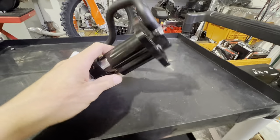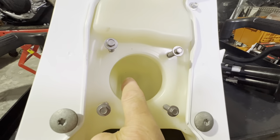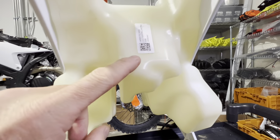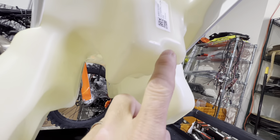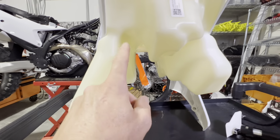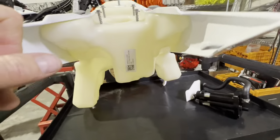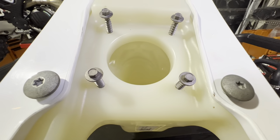Let's take a look at the new system — considerably different. What you have here is a drop-in system. This assembly unit will drop in to the tank. The tank has a different concept for how it gets fuel. You'll see this little bulge area right here — this is the fuel reservoir. The pump unit itself sits so that the lowest point is gathering fuel in this little section. There is no more fuel outlet at the bottom of the wings. The fuel is all captured and pumped out in this little chamber right here, where the fuel pump itself sits down into this little cavity.